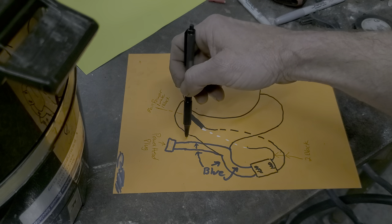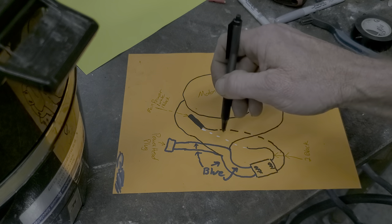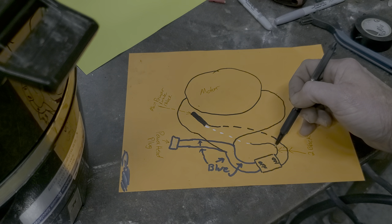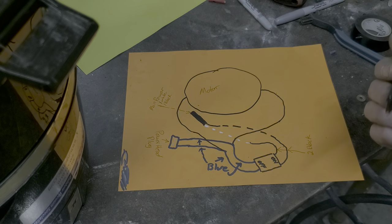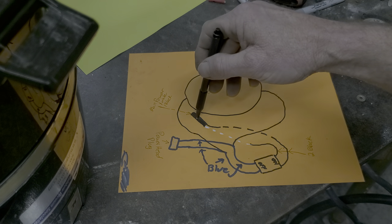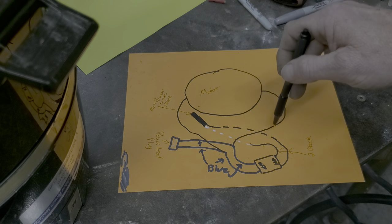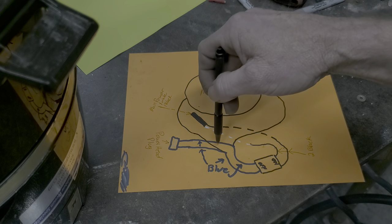The blue wires are easy - blue to blue to the new switch. But the side wires go to the blue wires. They do not go to the black wires. These are both black wires. If you hook these to your power wires, what you'll end up with is no switch - it'll come on every time you plug it in with no way to turn it off other than unplugging it. So the biggest thing is the main power: white to a black. It doesn't matter which black you put it on. The white to one of the blacks, the black power wire to the other black. And your wires on each side run in with the blue.